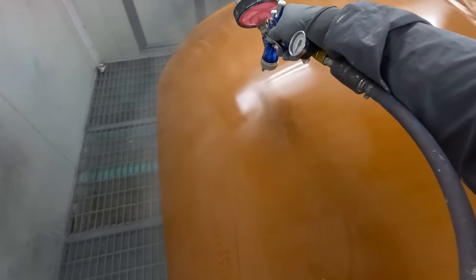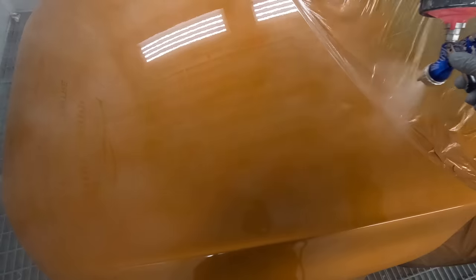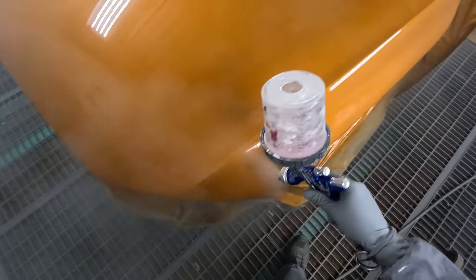I like to turn the pressure down a little bit on the flat panels. Don't go for glory - if you push through the edge and go for dead flat, it'll look good but then it won't look good. I want to hold a nice look with no buffing. Overnight or after a bit, it'll just die in the arse. I'm yet to find a clear that can hold a gloss while being dead flat on a bonnet.